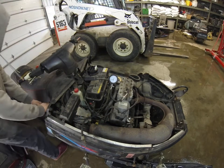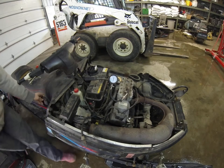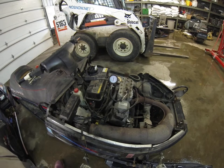Now we'll check the mag side. Pretty much identical on that side, right about 125 to 130 psi. So we've got a good engine here and we've got some videos that are running for you as well.